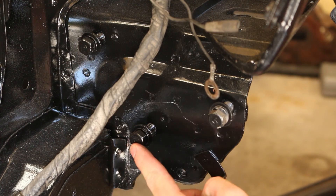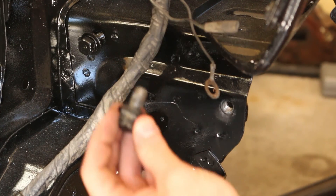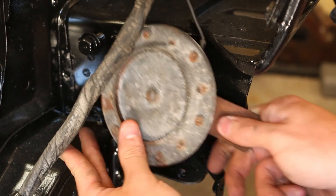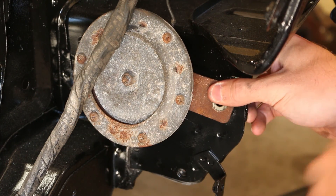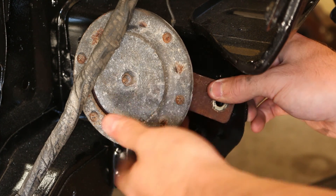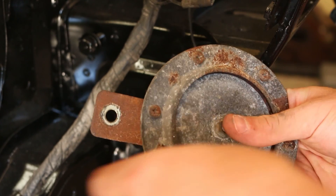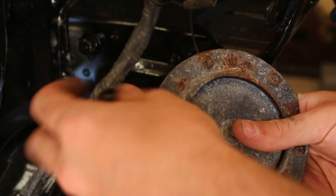There are three bolts — one, two, three — and we're gonna use this third outer one. The way this is gonna go is be positioned back like this, that way it's the most out of the way and tucked in. It's not as noticeable and bulky. So all we have to do is drill this hole out bigger to the diameter of this bolt, put it through and mount it.